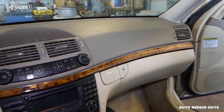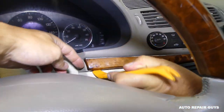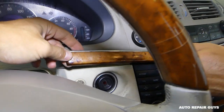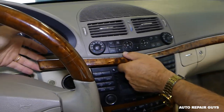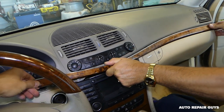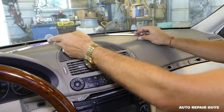It's very important how you do this so you don't cause any damage to your interior trim. Right here you need to pry this up — that's where the clip is. Take your time and don't pry anywhere else. Once you have this side pried, you're going to lift up and slide the whole trim to the right and pull it out.